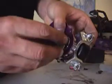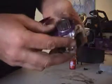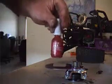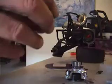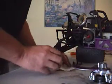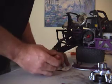Pop the bell through on the back side, pinion gear on the front side. Now, importantly, thread lock or Loctite. Now these come in mainly two different grades, red and blue. Don't use red because you'll never get it off again.